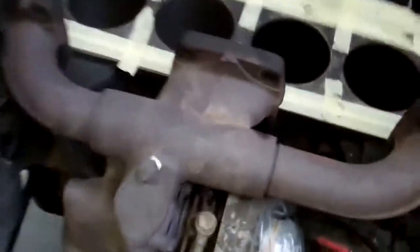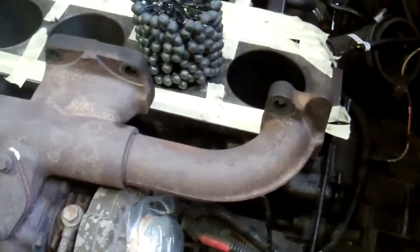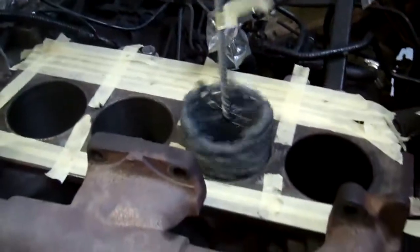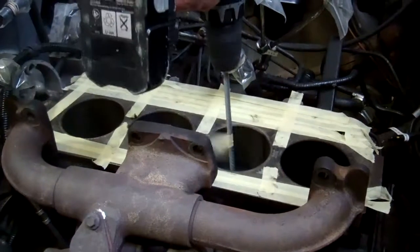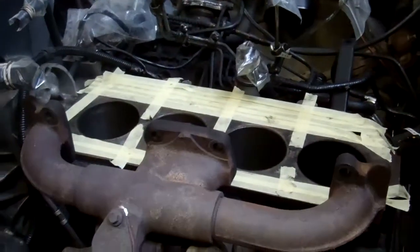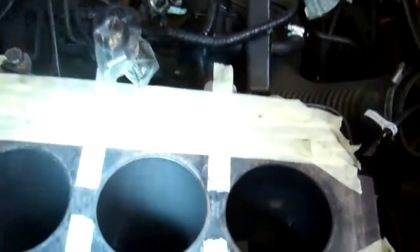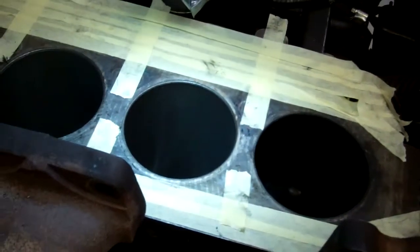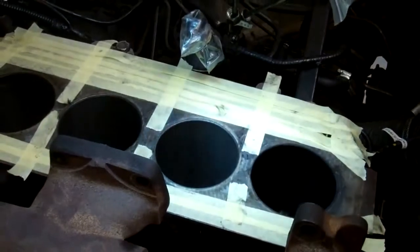OK, and that should leave that surface looking a bit better. We'll do the offending one and then we'll have a look and see if that's made any improvement. We have put a little bit of light oil on the inside of the bores before doing this. If I shine the light in — yeah, that seems to have made a drastic improvement on that. So that's how to deglaze, glaze-bust the inside of a cylinder block.